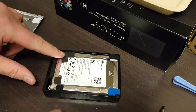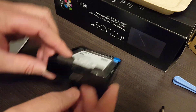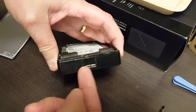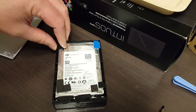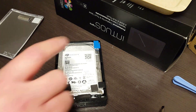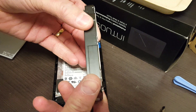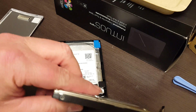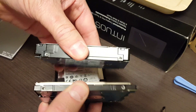So there's the aluminum lid, double-sided tape, a small amount of damage — nothing too serious. Now you'll see inside there are rubber bumpers that keep the drive from moving around, and there's also an extension on the end of the disk which provides the USB access from the outside. We're going to reuse all of this. The disk we're going to pull out is quite thick, and we're going to replace it with a slimline disk — you can see the quite significant difference in size.